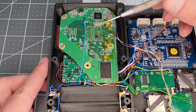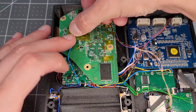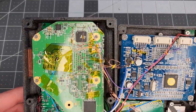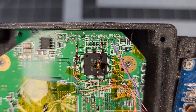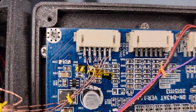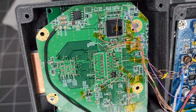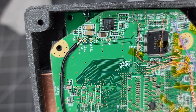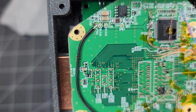Now the thermistor, which is used for overtemp protection, is soldered and we'll tape it down. Lastly, I wire up VGA to improve picture quality. These fine wires up here on the Wii go over to the upper left connector pins on the screen. Furthermore, it was necessary to connect this TP47 mode pin to 3.3 volts, which affords VGA switching.